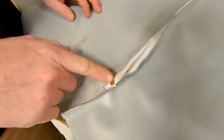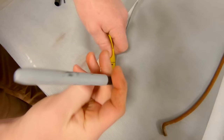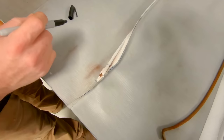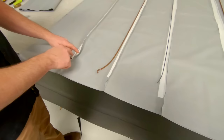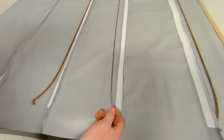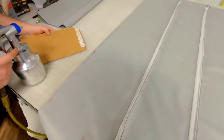Most of the time the listing is going to be a lot longer than the bow, so we'll want to measure. On this one we'll probably go back an inch, make a little mark, and then cut that with scissors. This little prep work that you do now is actually going to save you a whole lot of time once you're inside the car working above your head. We'll do the rest of the three bows and make sure they're an inch on everyone except for the center bow — as you can see it's a little bit different, it's held on by those teeth.